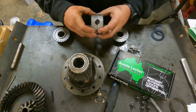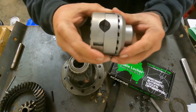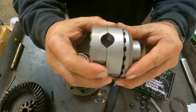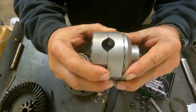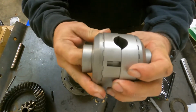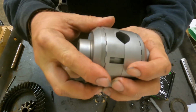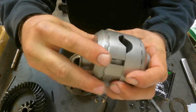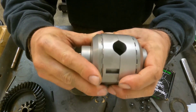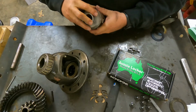You have your side gears that are going to be replaced. This is where your cross shaft will be inside. But you can see here that under power, you engage. In the front, when it goes under power, these slide in and turn both axle shafts, which are then locked and you have full power. So even if one tire goes up in the air, you are still turning all four wheels, as opposed to a limited slip or an open differential. When you lose power on one wheel, it slides 100% of the time. This is not the case. Once these lock in and it's under torque, you'll spin both tires, and that's what gives you the traction you need. So we're going to slide this into here and go through that process. All right.